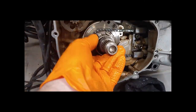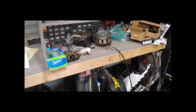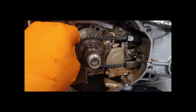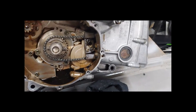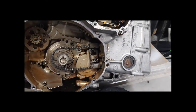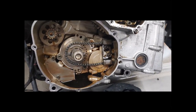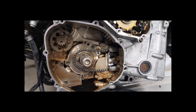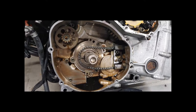There's the oil we expected. We have a couple more needle bearings to pull off here. The whole basket is set out of the way. I believe the goal is to get this chain off right here, which frees up the lower half of the block from the upper. Then we've got to go to the other side and get out the stator. I see some people use specialty tools for the stator but I also see you can use a random bolt that screws into it to pry it back. Let's go ahead and move to that side after we clean this oil out.